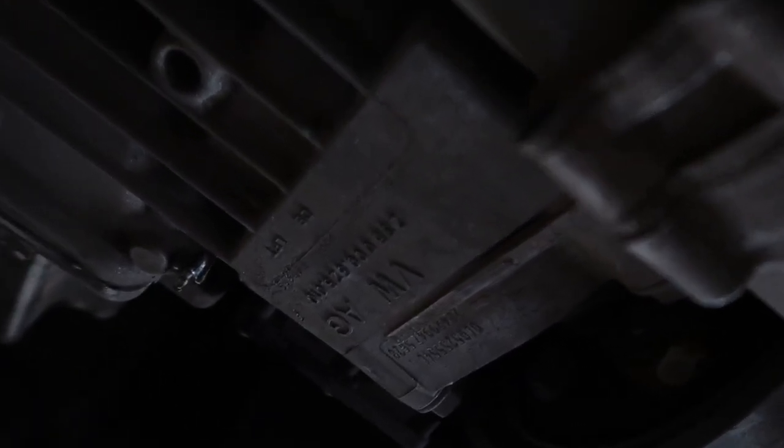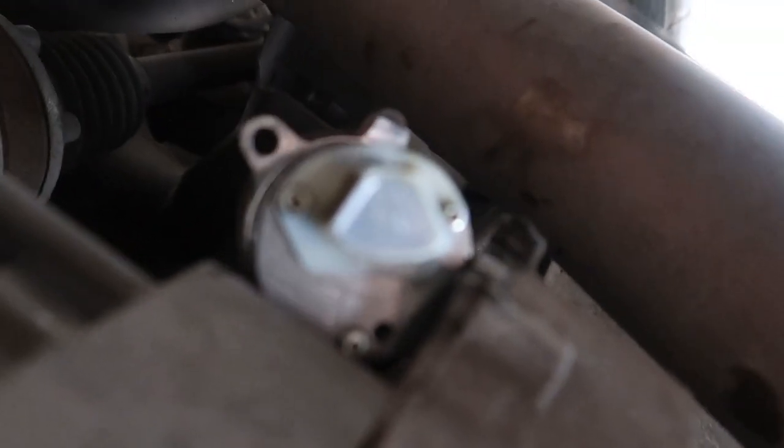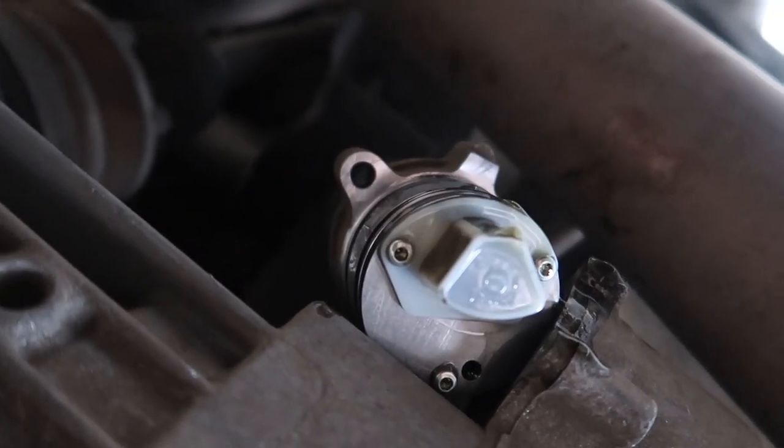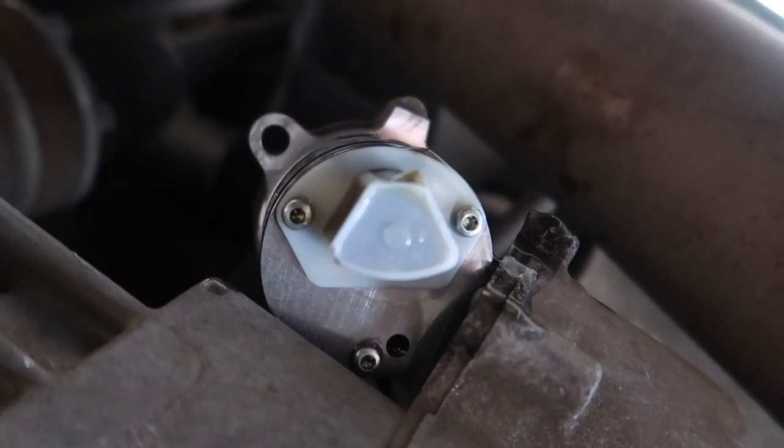It's difficult to show when I'm under the car, but one of those 10 millimeters goes right there and there's another one on the opposite side up top. I'll link my Haldex DIY video in the description — when I have it on a lift you can clearly see everything. You get these two 10mm bolts and wiggle the housing off; there's an electrical connector you can take off and then the whole housing comes out. Then you take the screen — it's more of a screen than a filter — clean it, and the seals are on this housing as well. There are two T10 Torx bolts to take that screen off.